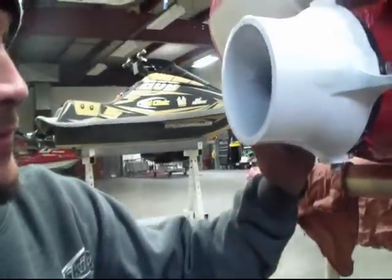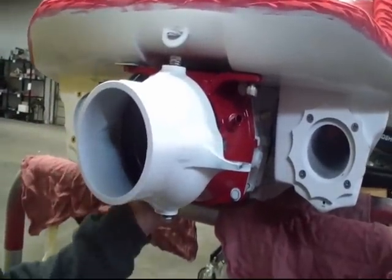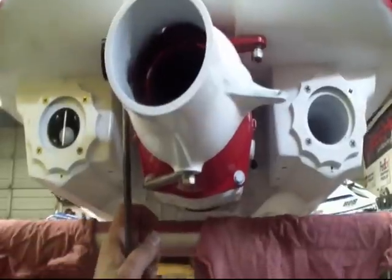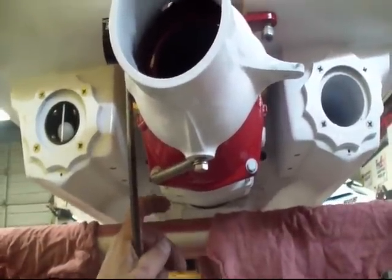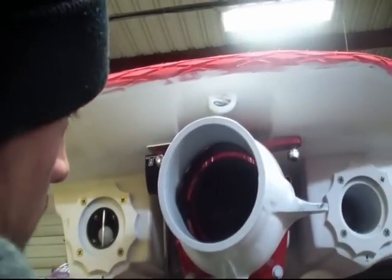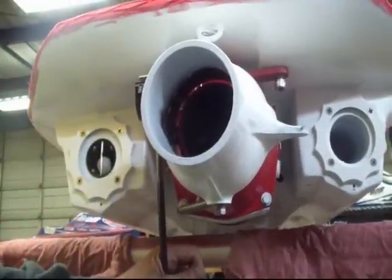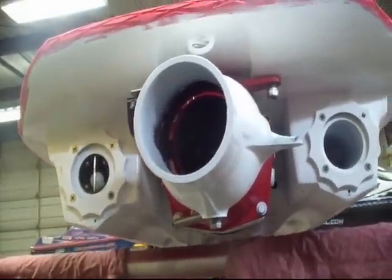So I'm going to show you how I can clean that up and make my adjustments over at the back of the pump. Since the drive shaft is too much to the left, I'm going to loosen the front pump bolt right here, and then give slight pressure on that one side to push the pump in a little bit closer to straighten it out. As I'm holding pressure, I'm going to tighten that front bolt to hold my set point.